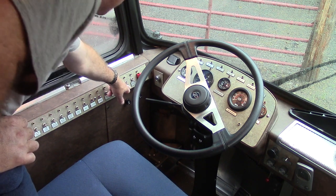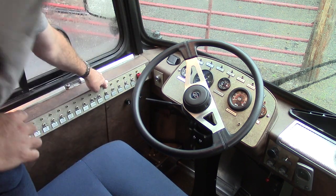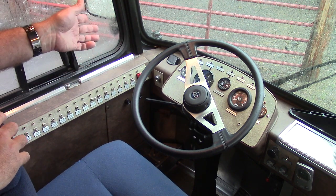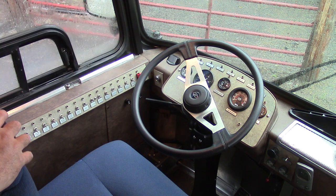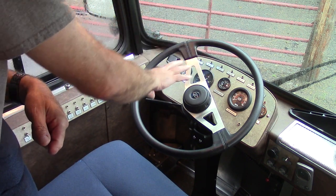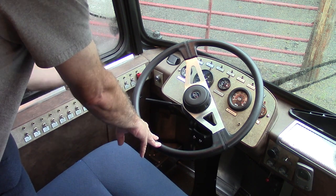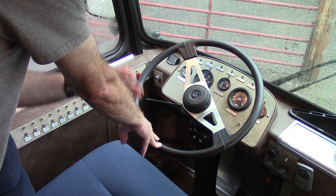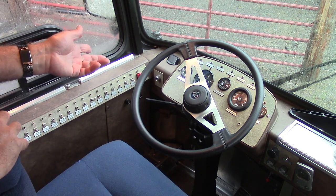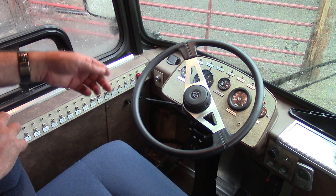This is the alarm disable. When you first start the coach, you get a lot of alarms that sound until the air gets up to 90 and stuff like that. To keep that from being annoying, you can flip that alarm disable switch. All of your lights on the dash will still blink showing you that you've got an alarm situation. And then this is the fast idle — when you flip that up, once your air is built up, it'll rev your engine up to a little bit higher RPM. It's used mainly when you had the bus air conditioning, to keep the engine running fast enough to maintain enough voltage on the alternator to run the air conditioner.